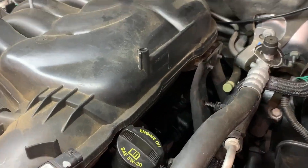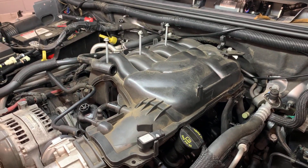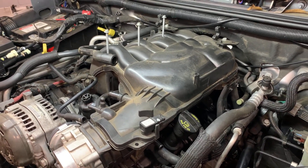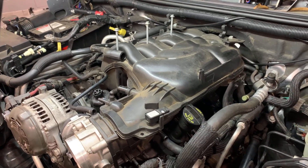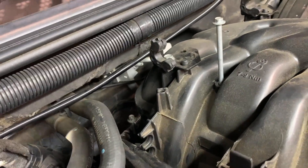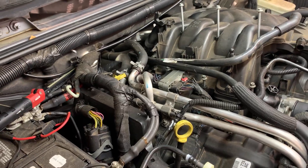You don't actually have to loosen that bracket. Just pull all your intake bolts up so they're out of the way when you go to pull it out — so they're not catching on the bottom plenum or anything else. There's actually one bolt back here you don't want to miss. The others are pretty obvious.